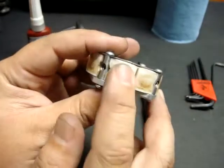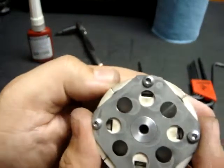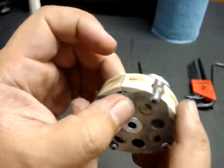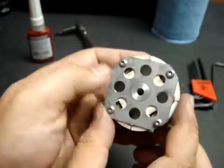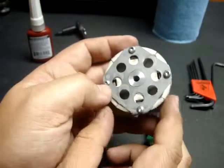The shoe, as you can tell, there's a lot of scouring and wear. And as you can tell from just this over here on the side, you can tell that it's been worn down. There's a lot of material that's been taken off of this clutch, so this clutch has seen more than its fair use of its lifetime. It's time to get rid of these shoes and put in some new shoes.